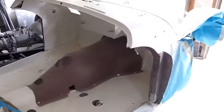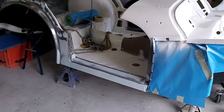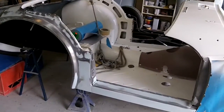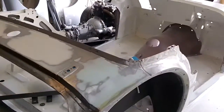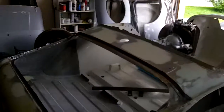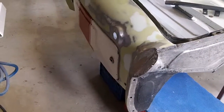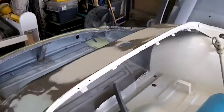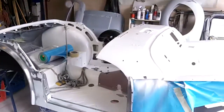I really want to get the rest of the tub in epoxy before I go any further. I did try to buy some more epoxy primer this morning — I only wanted really an additional quart. The NAPA that's close to me only sells it in gallons, so I'll probably end up having to buy a gallon to finish this car. I still have a fair amount to do anyway — all of this area, the trunk area, and inside that spare tire wheel opening. So probably not a bad idea to have a gallon of it anyway. I've also got some 400 grit sandpaper on order for my Dura-Blox — so we'll go grab that in a little bit.